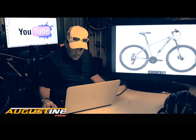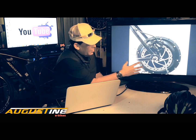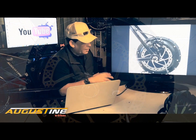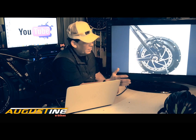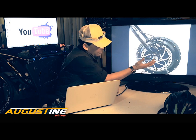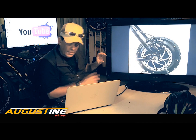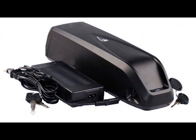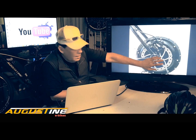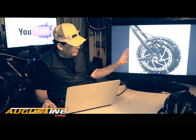You want a bike that is comfortable to ride, is well designed — that's the foundation for the whole thing. There are really three working parts. You need a motor. In this particular video we're only focusing on a rear hub motor. You can have a mid-drive, which basically replaces your crank and your drive system — they're more expensive, a little more complicated, and require more maintenance. The standard size dropout here is 135mm, so you just basically take out your own wheel, put the wheel in with the motor, and you're pretty much ready to go. This is more of a plug-and-play system. Mid-drive has higher torque and is better for off-road, but if you want to commute or ride 40 miles, this is a great solution. They're relatively inexpensive, they'll last forever — they're terrific motors.